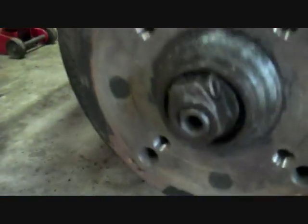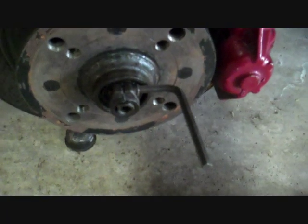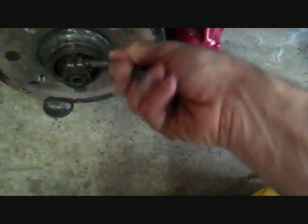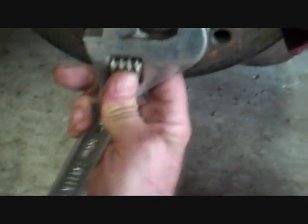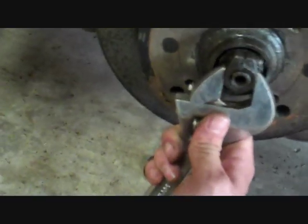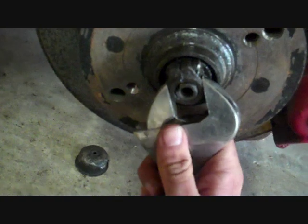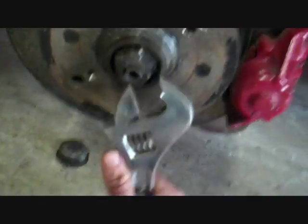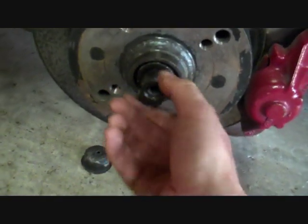And then there's the bearing tension nut. You can see it's got an Allen key locking grub screw. So that just takes a 6mm Allen key to loosen the lock nut grub screw off. And then if you needed to tension up your bearings, just a simple spanner sits on there like that. And because this is the left hand side and it's got the reverse thread, you would turn it anti-clockwise to tighten it up, or clockwise to undo it. So completely opposite for the other side.